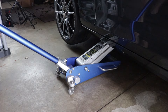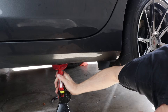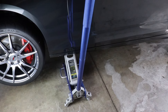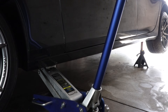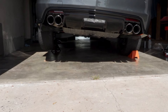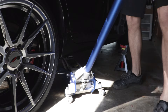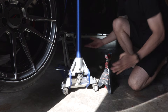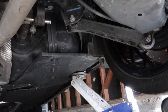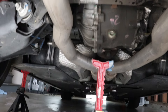Now let's look at raising the rear of your Cadillac. Remember — when we raised the front of the vehicle it raised the rear wheel. This is a great opportunity to put a jack stand under one of the rear pinch weld areas. Once you have a jack stand under there, just lower the front of the vehicle and the Cadillac will sit right on that rear jack stand. Now you can see there's plenty of room to get under the car, but only the left side is raised, so if we want more room we'll want to raise the other side. You might think to just put your jack under the other side and raise it up, but once you do that there's not really a good place to put your jack stand — it's pretty bare underneath, and currently your floor jack is taking up the only official jacking point. You might want to put a jack stand under the differential, but my jack stands aren't quite tall enough to reach.